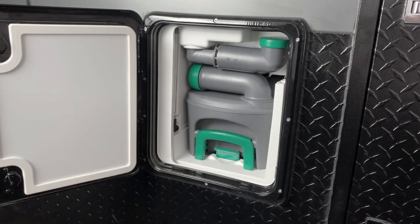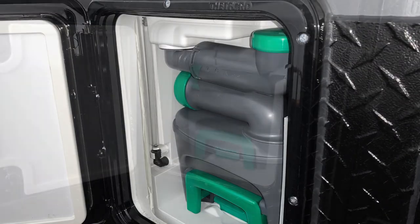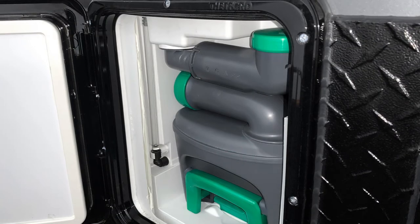The cassette units may be different colors from model to model but their basic functions are the same. One difference worth noting is with the Mount Hotham — above the main unit you can see an extra spout connected to a small cistern which holds some extra water when you activate the flush function. You can see how much water is in the system with the water level indicator on the side. If you accidentally use all the water in your normal tanks and then need to use the flush, the toilet will switch to using this extra stored water. You can add more via the extra spout — this swings out and you can remove the top cap.